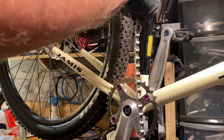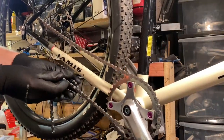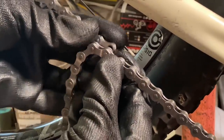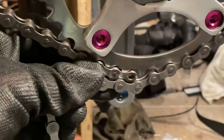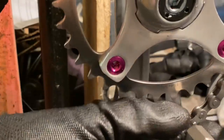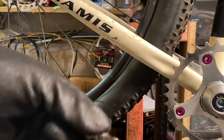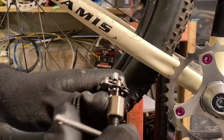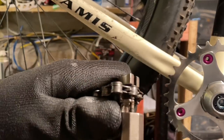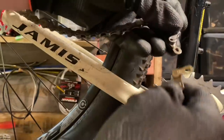When setting the chain length on a single speed bike without an eccentric bottom bracket or horizontal dropouts — this is a vertical dropout frame — I'm going to have to use a chain tensioner. To get it as close as I can, I picked up some half links so I can use those if needed. Normally you can't connect two incompatible links together, but if you replace one with a half link, that allows the chain to be mated again — it's basically just a link that can bridge unfamiliar links. You only ever need one per chain, but I picked up a couple so I can do other setups.